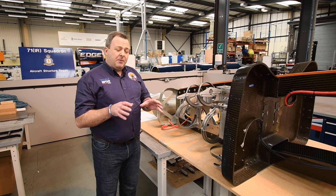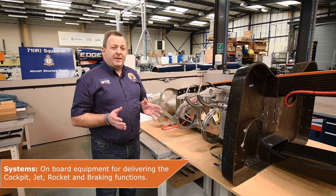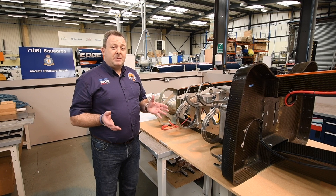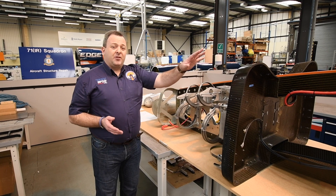At the front of the car we had to be able to remove panels because we were starting to package lots of systems and equipment inside the car. With those panels removed, all of that equipment still had to be supported, so the blade had to be super strong but also had to connect to the front of the monocoque.